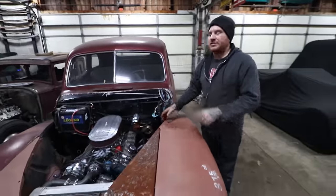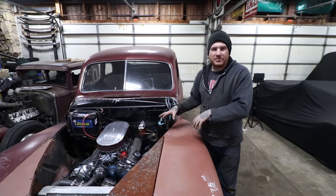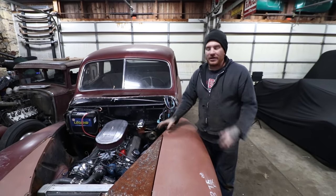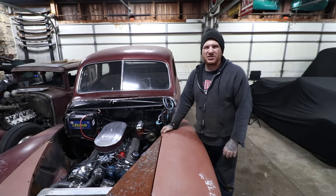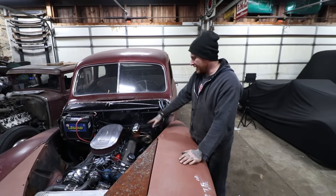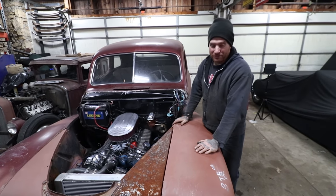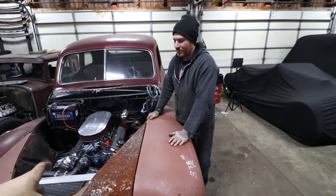Everything's pretty darn good. We still have a couple of little exhaust leaks. I think I'm going to remake the little downpipe sections — we reused the flared bell section and even with new gaskets it's still leaking. It was kind of cut up and I'm just not happy with it. But now that we got the front sheet metal bolted on, we've got to take it down the street.